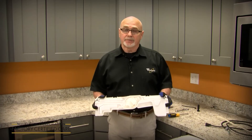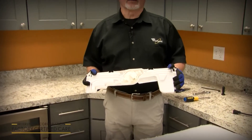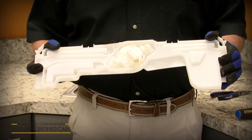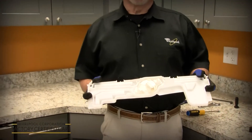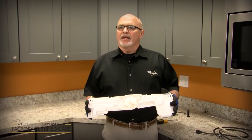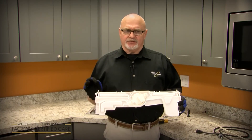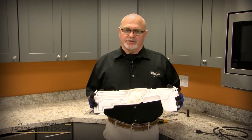To recap: the unit has a new drip pan and float assembly — one of the last things to install before the front toe panel. Run a short installation service cycle or rinse only to make sure you get water in the unit and check for leaks before putting the toe and insulation panel on. The install service cycle key dance is 1-2-3, 1-2-3, 1-2-3 — all LEDs come on, then you can rapid advance through steps: step one is drain, step two is fill, step three is wash. It's a short five-minute cycle so you can check for leaks.